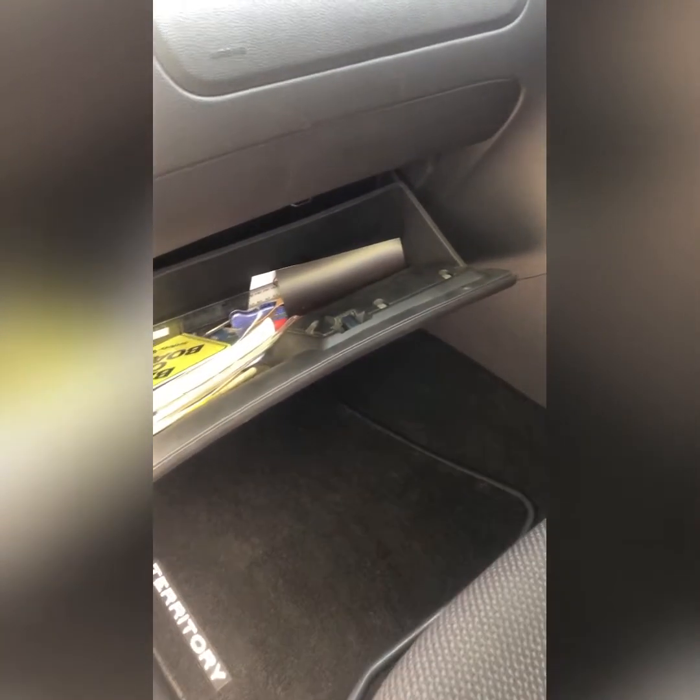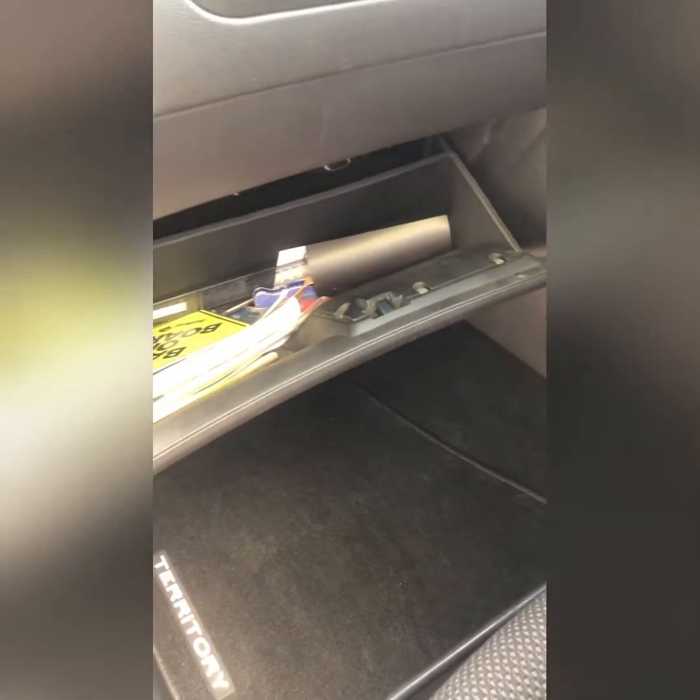On my particular model, the in-cabin air filter is under the glove box, or behind the glove box. So on the passenger side, open up the glove box. On the left, you've got these plastic holders that hold the glove box in. You're just pushing those inwards to drop the glove box down. It feels stiff, but if you pull them at both sides, the glove box will drop down.